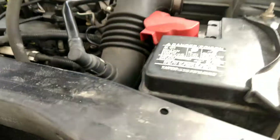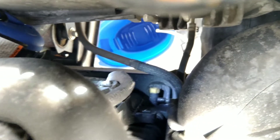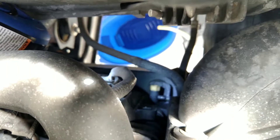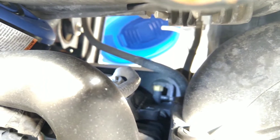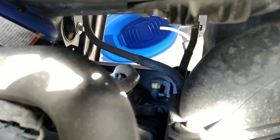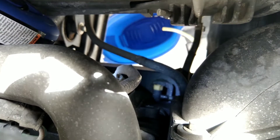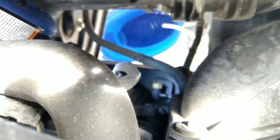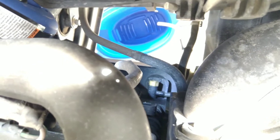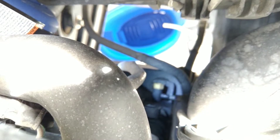You can see it right here — that yellow bolt right in the center of the screen where I'm trying to zoom in. You need to open up the yellow bolt and it usually opens with a 19-millimeter or a three-quarter wrench or socket. Right next to it I've hooked up the plastic clear pipe.